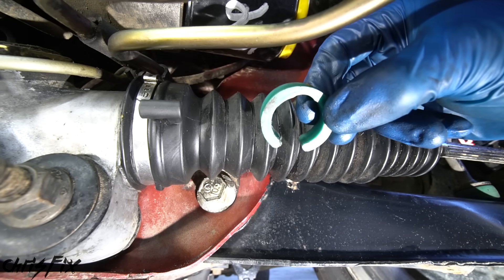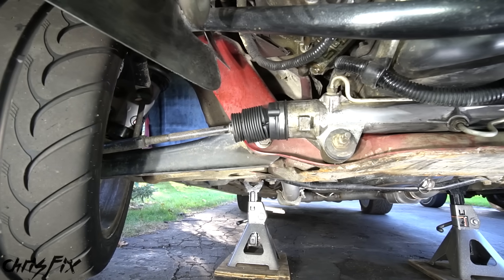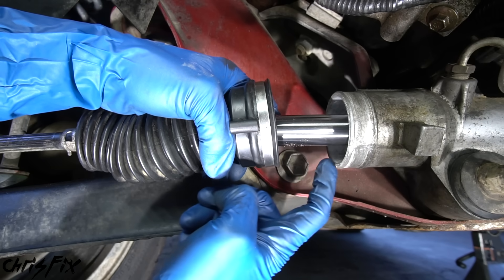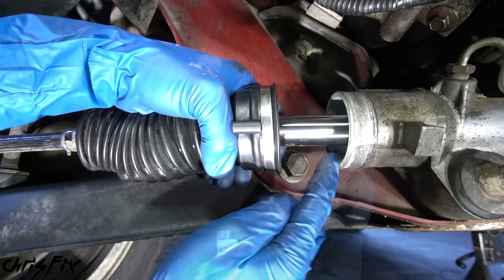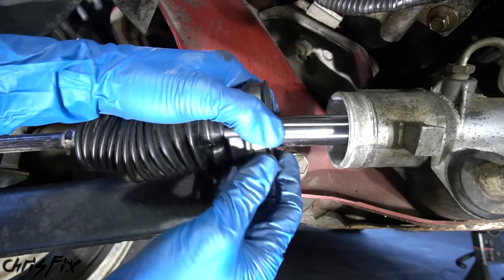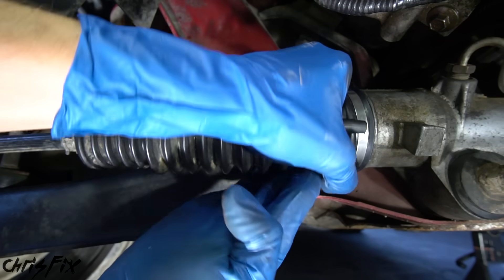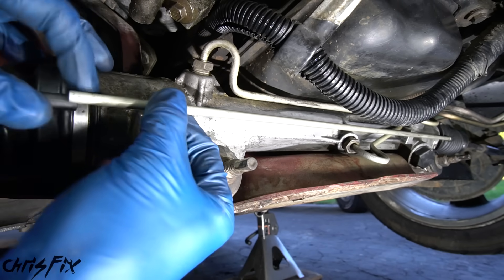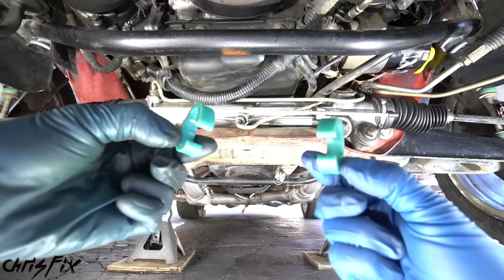One side done — that's all it takes to get the steering rack limiters out and get more steering angle. Now slide over to the other side and do the same thing: turn the wheel outward for more access and remove the boot. A tip: when you remove the boot, if you see any fluid coming out, that means the seals in your steering rack are bad. A couple of drips is not a big deal — clean it up and keep an eye on it. But if a lot of fluid comes out and your power steering is low, consider replacing or rebuilding your power steering rack. Get the other rack limiter out, push the boot back on, put the vent tube back on both sides.